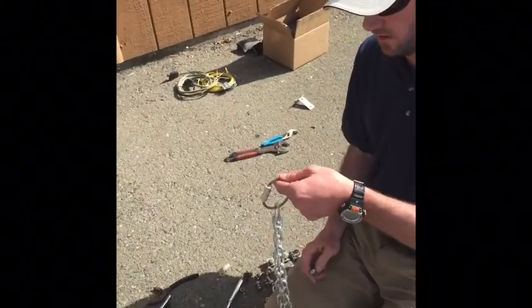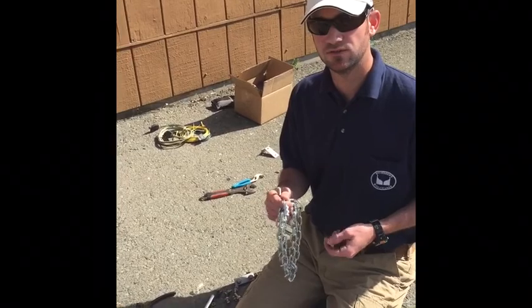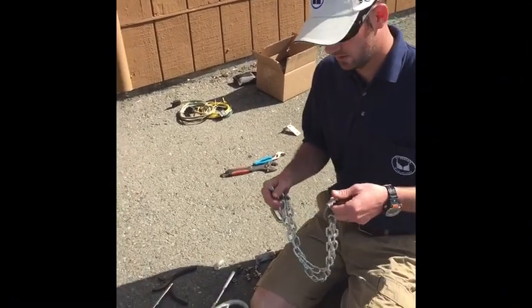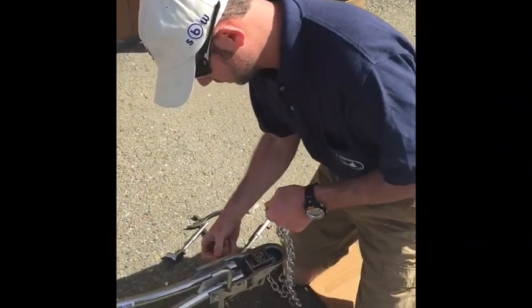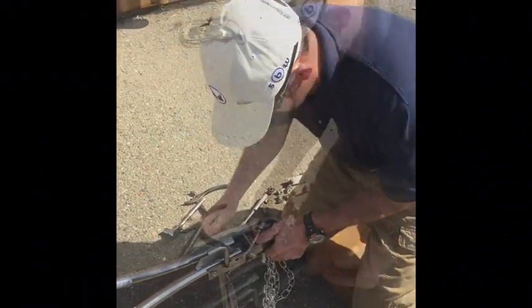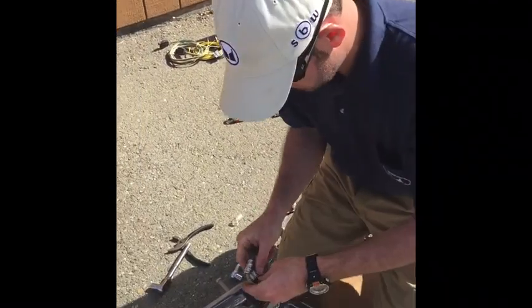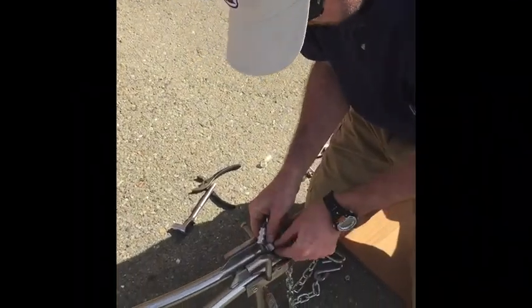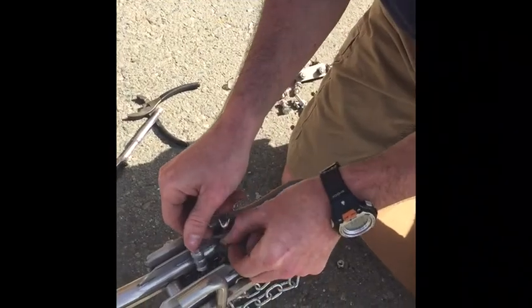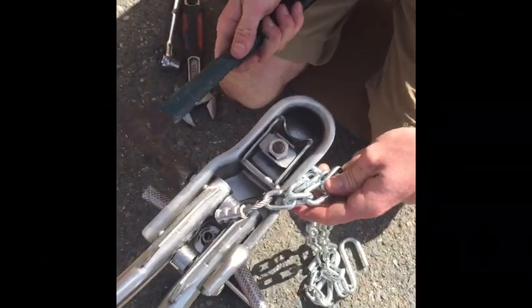The front part on, but this is an important part. So now we're going to install the chains that attach to the vehicle when the boat's riding on the trailer. Same thing, bolt through the middle. And now you're going to put this metal insert through the center of this and down through here, and the bolt should kind of look like this when they're installed.